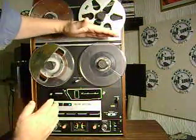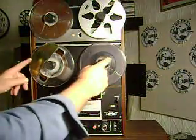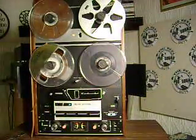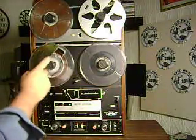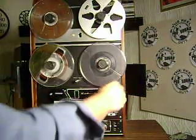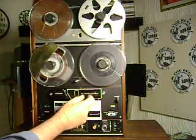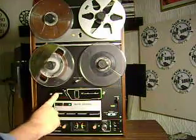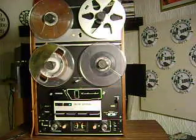Before, when you just used the lower end of this deck, you just went from post to post when you threaded your tape for playing in the forward direction. Now it's different, because there's a record head sitting over on this side. You actually have to take your master tape and get past that record head and then go through the cycle here, where the duplication process will now pick up this tape on a playhead and throw it over to this record head at the same time it's playing, for this tape to be recorded to.